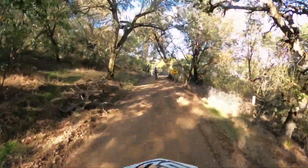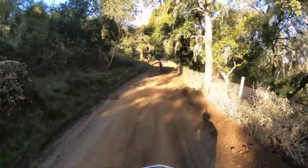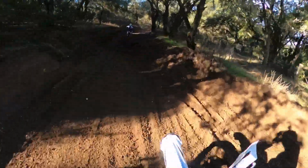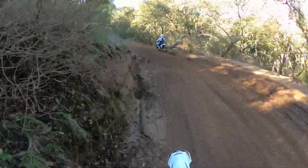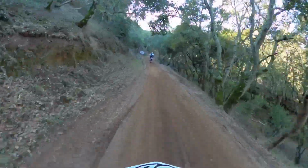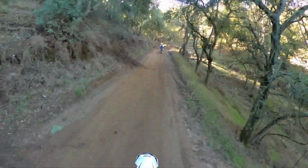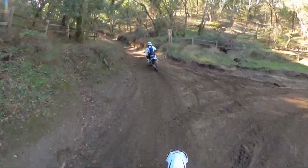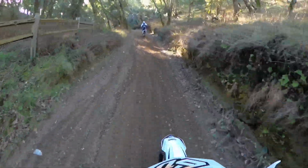As the bike continues to get ridden and breaks in, you'll start to hear a little bit of chain slap when I get on the brakes and on the chatter bumps. It's absolutely normal. Every bike does it. The chain was just starting its first initial stretch, and I did go back and tighten it later, and then of course it stretched again, as it's supposed to. I'll leave you guys there, but I'm just having a blast on the bike at this point.